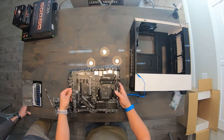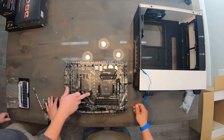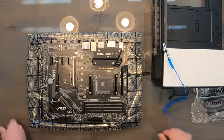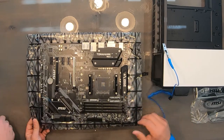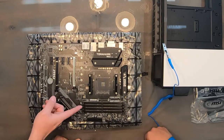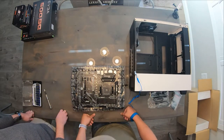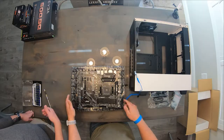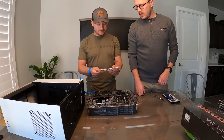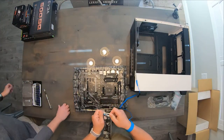That's kind of cool looking — it's a pretty nice looking board. You can see right there's your slot for your hard drive, CPU slot with a little bit of plastic protection you can remove later, and then your four DIMM slots for your RAM. One thing we might want to double check is the order that you put your DIMM slots in. So the little back plate right there is gonna go right in this slot from the inside — it snaps in, just pushes in and it'll click.